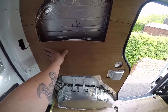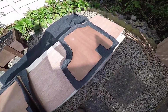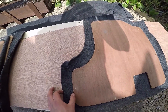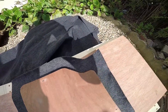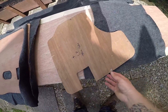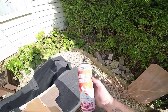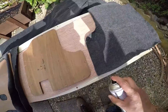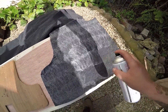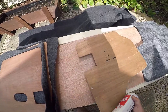Where my hand is, that will all be tiled — all of this should be covered — and you get all this storage space behind. So this is the four-way stretch carpet. Cut a rough shape out, giving yourself a good overhang all the way around. Make sure you mark which way you want the carpet to sit. Get your high temperature adhesive — a nice little coat on both surfaces, do your door as well.